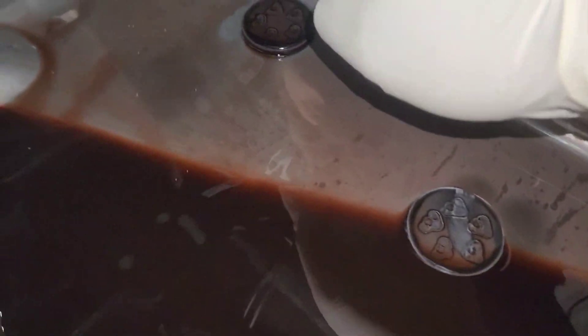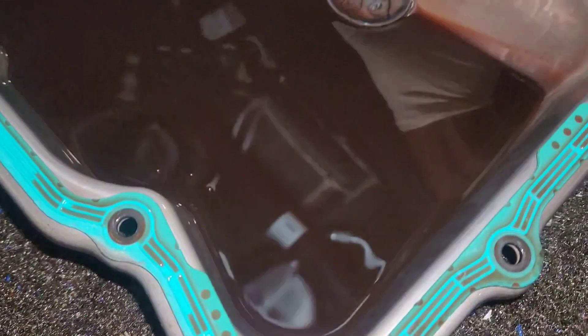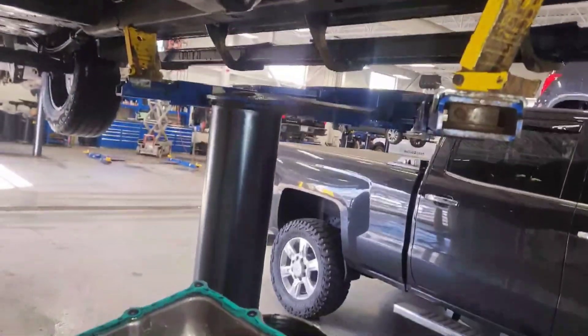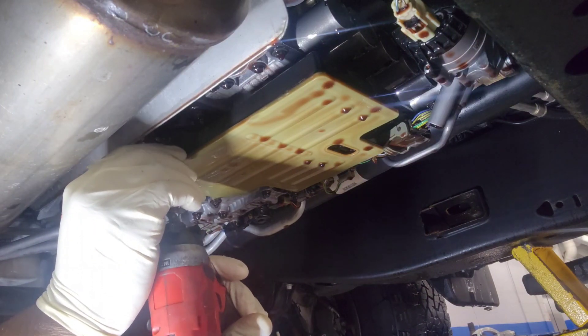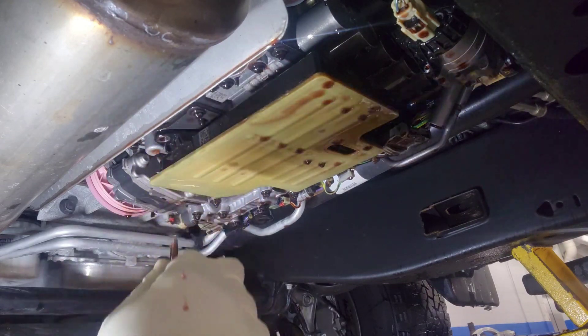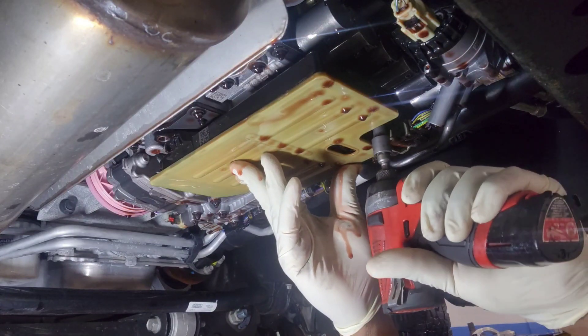This is the fluid magnet. The magnet's job is to collect dirt, debris, and clutch material inside the transmission. Look at the fluid — this vehicle is at 25,000 miles and the fluid already looks like that. That's why I recommend people to change the transmission fluid every 40,000 to 50,000 miles. Drop the pan and refill at least — even if you don't replace the filter. I'd suggest every 50,000 to 75,000 miles.